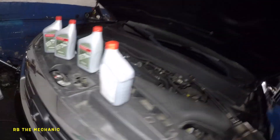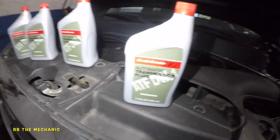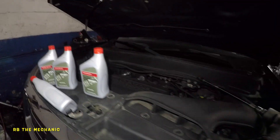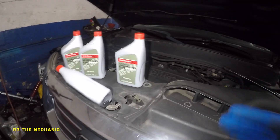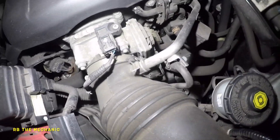We've got a 2012 Honda Pilot and we're gonna change the transmission fluid. The customer got it from the dealer — it's DW1. You're gonna need four quarts, no measuring needed. You could take it out and measure it, but if you don't want to, just put in four quarts. There's a dipstick down here all the way below.